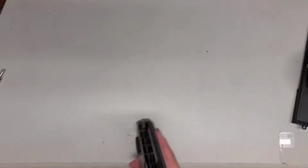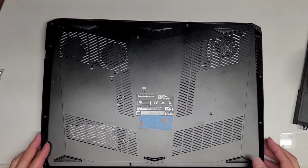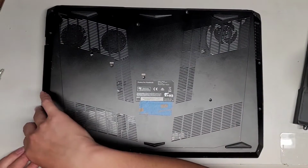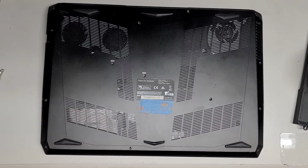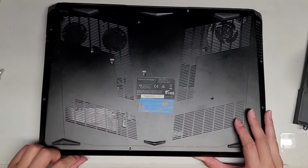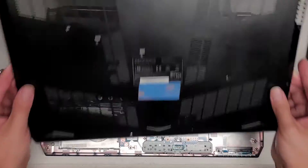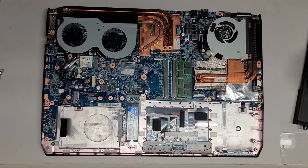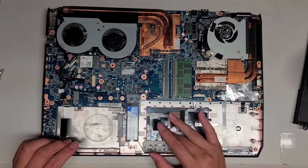You want to carefully, slowly close it because these screws are supposed to help hold the hinge in place, and once those are removed, it's a little bit more fragile. All right, let's go ahead and pull the cover back out. Use the suction cup to make it a little bit easier again. Okay, so once you got the front part of this cover up, kind of just wiggle it and push it forward this way. Okay, got the cover back out pretty easily. Again, make sure you pressed and held the power button to drain any power in there.